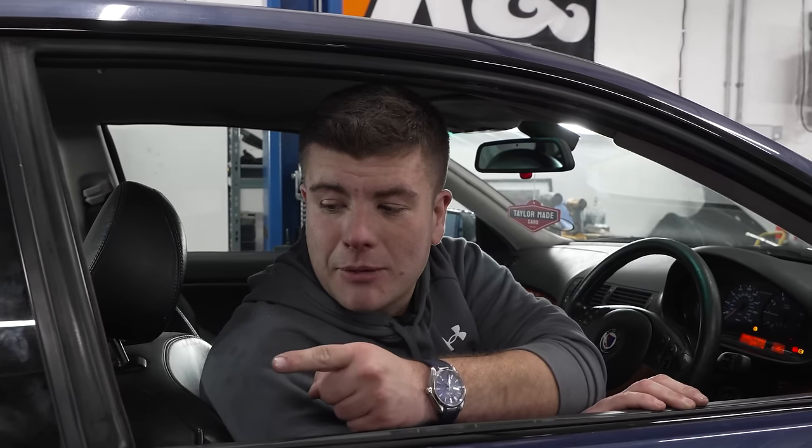So I will probably fit that diff over there at a later date because that has a higher ratio. Higher ratio. It's longer, which means the revs will be lower on the motorway, which means it still maintains its GT cruiseriness. But if I'm correct, at the moment this will be faster. Very fast, isn't it? Yes.